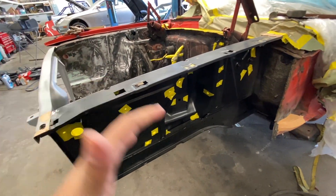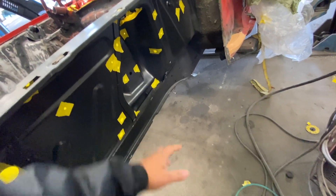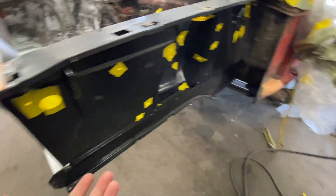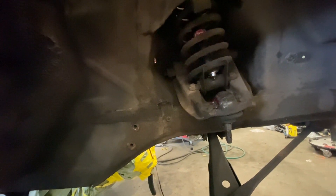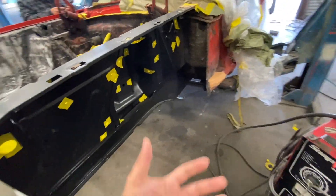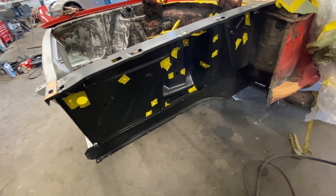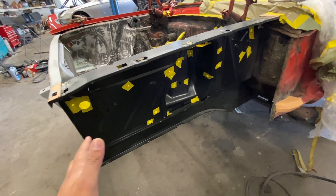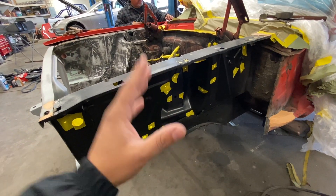Since everything is ready to get the suspension installed, I had to make a decision. I really like the clean look of the apron, but the other side still has all the original tar-style undercoating and it's on there really good — I tried to peel it and couldn't. So to expedite things, we're going to shoot both sides with a fresh coat of raptor liner. That'll give us a way better look than the factory stuff, protect the inside from rust, and it's easy to clean versus paint that can get nicked and chipped over the years. So we're going to remove the other fender, remove the rest of the suspension, and shoot both inner aprons with raptor liner.